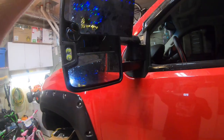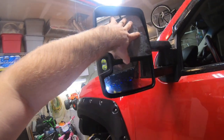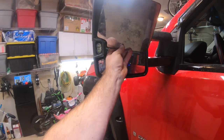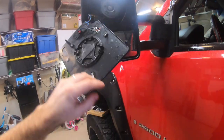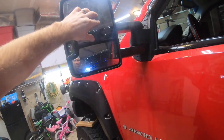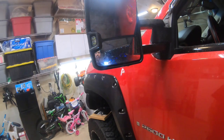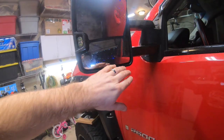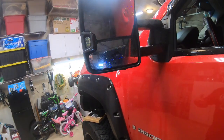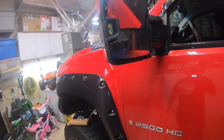The cool thing about the factory mirrors, if you guys are trying to replace the glass in your factory mirrors, they come off a little bit different. Same type of thing. You need to articulate your mirror forward, but then you kind of shift the glass itself up and then rotate it back down and it kind of pops off. It doesn't quite have the same mounting design. Now you can get the adapters through Boost Auto Parts, all that. Same type of thing. The lower mirror here, get your fingers back there. I'm not going to do it because I don't need to break more plastic mounts off. Just pop right off. A lot of the factory mirrors, you actually have to break a hole through them here because they got a screw back there. Then again, you can still buy the aftermarket replacements, but you got to buy an adapter to just click on instead of having to run the screw through there. So neither here nor there.